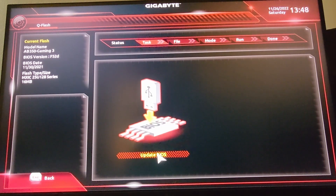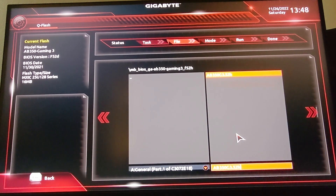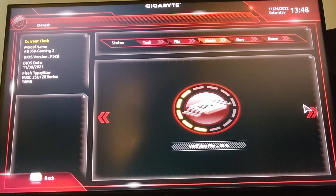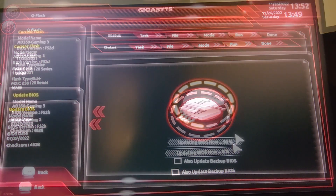It's going to show us the flash drive I have plugged in. We select the proper firmware version and select the name. This is the part where you always have to cross your fingers and hope nothing goes wrong. Fortunately, a lot of good motherboards out there have BIOS flashback, so you don't have to worry about it. We skip ahead as this part takes about five minutes. I do recommend selecting to back up your BIOS — I forgot to, but fortunately nothing went wrong. We just let the update run and we're right off to the races.